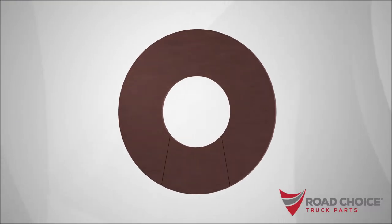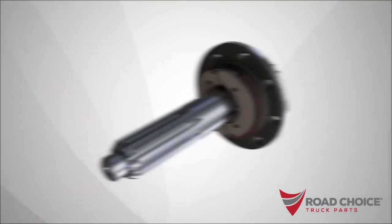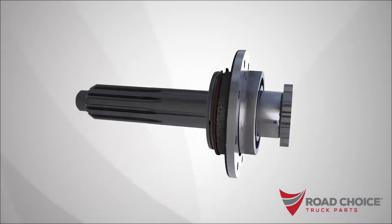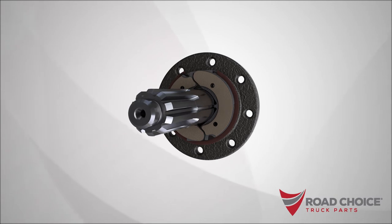Every Road Choice clutch comes with a fiber spacer to compensate for the material that's removed when the flywheel is resurfaced. This spacer is installed between the clutch brake and the transmission input bearing retainer during installation, so that the clutch doesn't need to be adjusted to compensate for material loss.